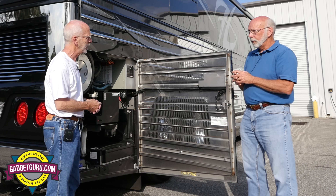In here, just an air cleaner — that's good. This is my dash AC unit. Anything else we need to know about here? In your particular coach, this is where the cutoff switch is for your tow vehicle, though that varies from converter to converter. This controls the electrical going out to the rear of the coach connecting to the car for turn signals and brakes — if I have a problem in the car, I turn that off and this keeps on. It's a pretty simple compartment.